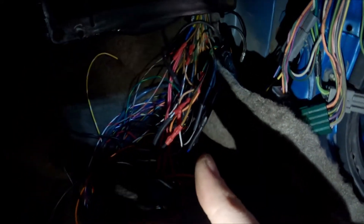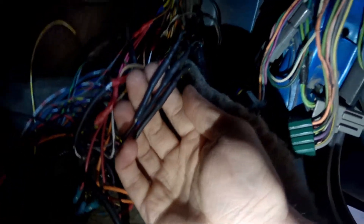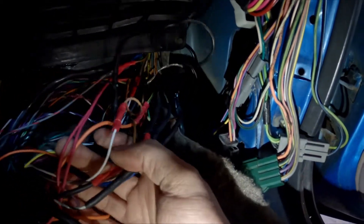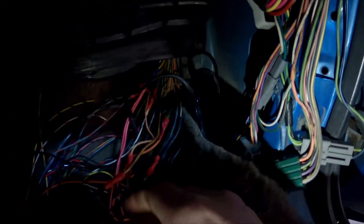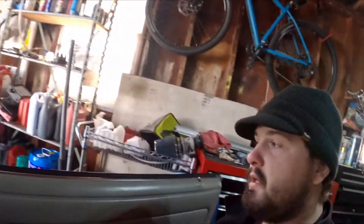I was able to get the car up and running in TunerStudio and got some things figured out. I did a lot of permanent wiring — I used butt connectors, heat-shrinked everything and did it right. But then I noticed a lot of things that weren't working right and had to go back. There's just a lot of unfinished wiring in here that I had to redo. I also had to add an extra relay here for the fuel pump because it wasn't working otherwise. Mostly, I think everything I need to use is hooked up.